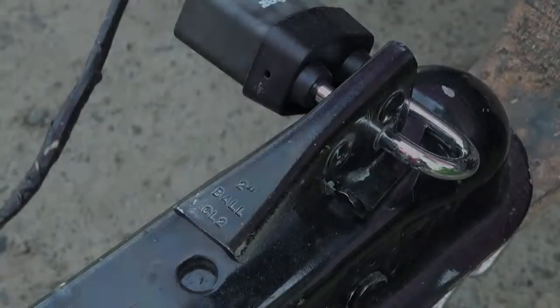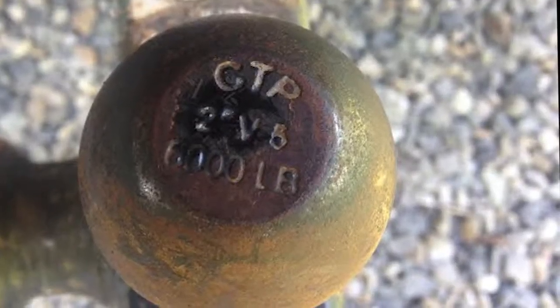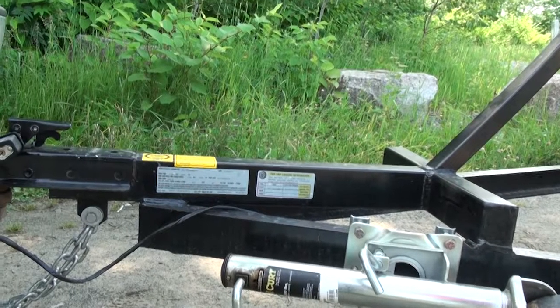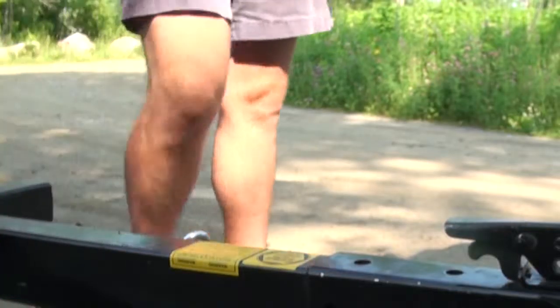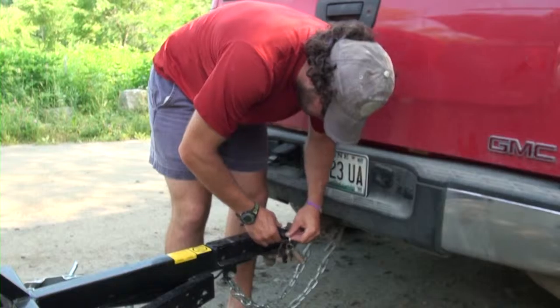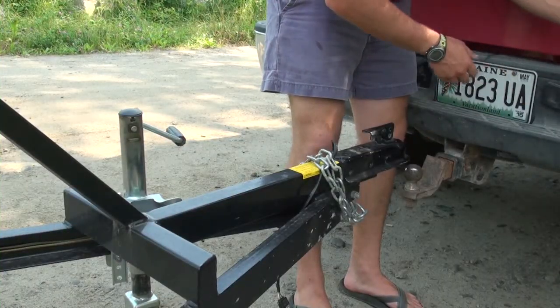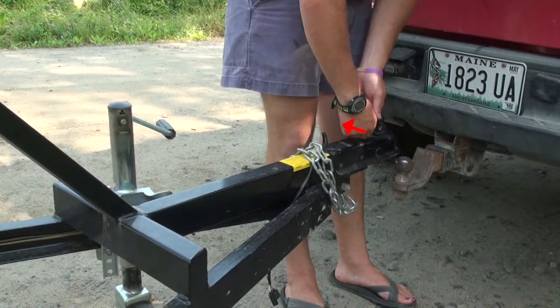Towing and transportation guidelines. All trailers of the Paddle Sports Fleet have a 2-inch ball coupler and 4-way flat light connector. To attach the trailer to the tow vehicle, unlock the coupler lock from the coupler latch and raise the coupler latch to the vertical position.